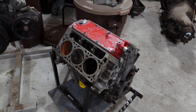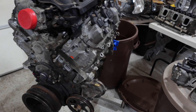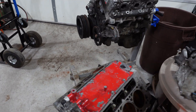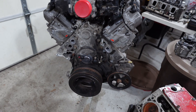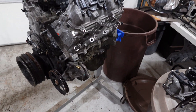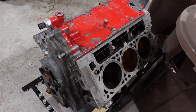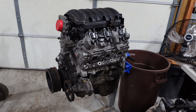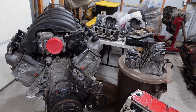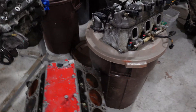Sknod and Dickey has a piston and rod combo - I think Wiseco pistons and Molnar or K1 rods. I think I can get one of these fixed - new lifters, go through it - and the other one might need to be bored and get the piston/rod combo. Brian Tooley also makes a couple of cams for this, like a Truck Norris Junior cam. You can make 360 horsepower basically with just a cam change, and it's a hundred pounds lighter than an LS. Imagine that in a Miata, an RX-8, another turbo Buick, or an S10.